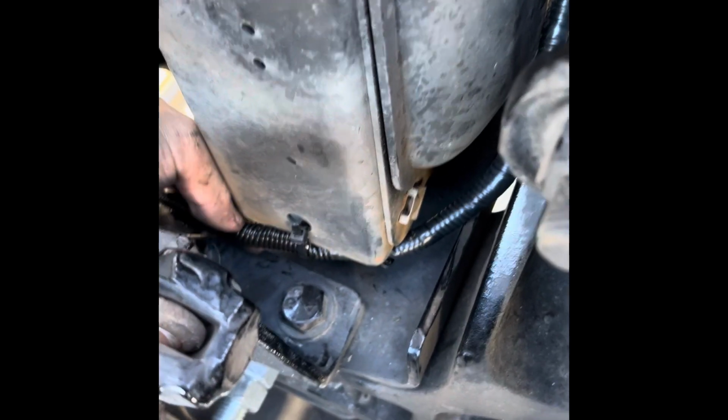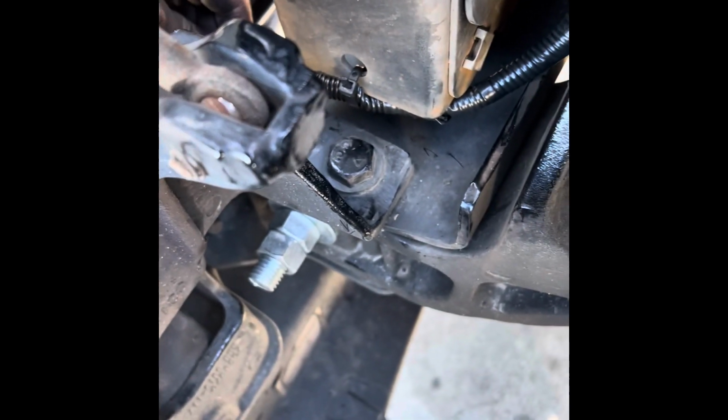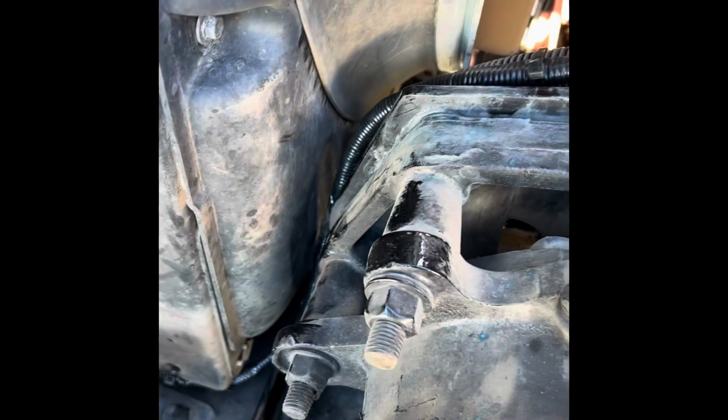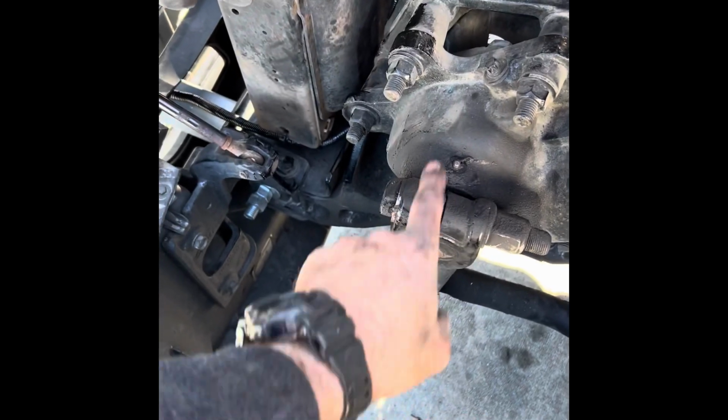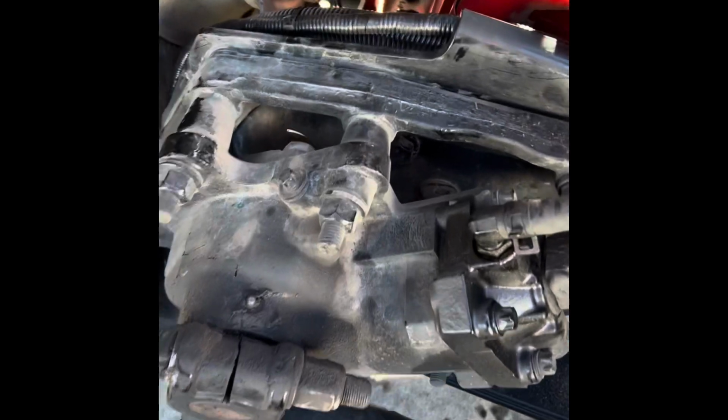This is the back of the brush guard. I run it right here through the brackets underneath the fan and radiator shroud. I just run it under there, zip tied it here. And I did start wrap taping it all the way from here, just because it's going from the engine bay. So I wrapped it with electrical tape too. But basically I ran it right here beside the pitman arm. I mean, not the pitman arm, the gearbox on the inside of the frame here.